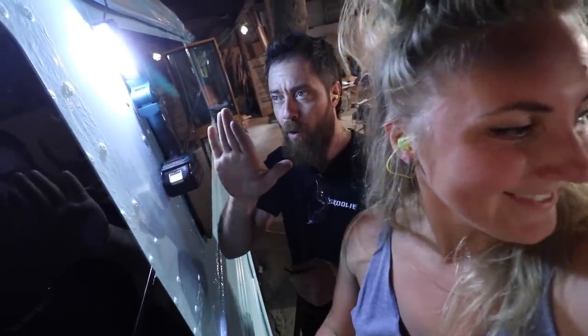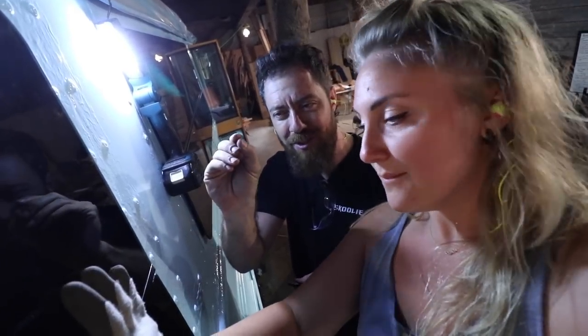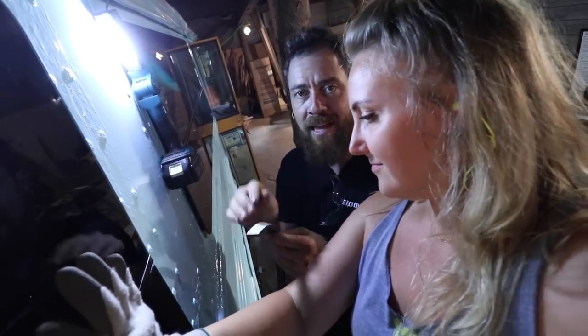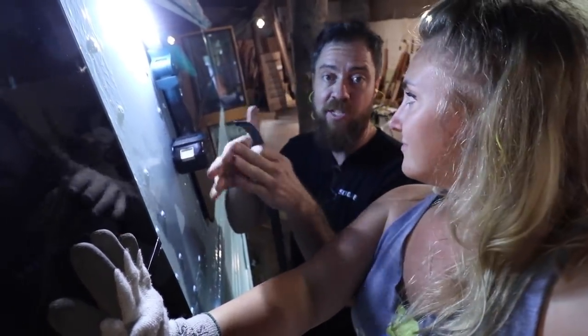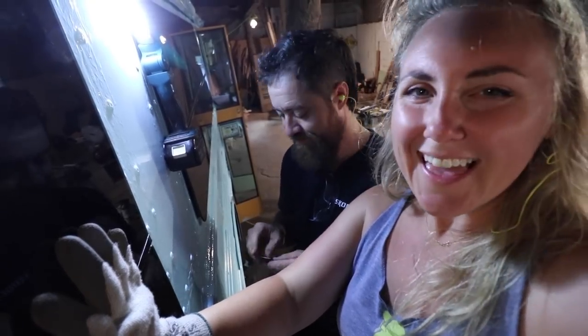The weather stripping meets the metal, but it's so close that there's just a hairline gap there. So what we're doing is backfilling that area with weather stripping. We did it on another window as a test, and when we pushed it on, it compressed perfectly and made a beautiful seal. So we're gonna add just a little bit more. Yay. This is a special shot.